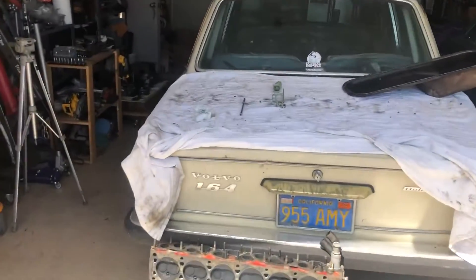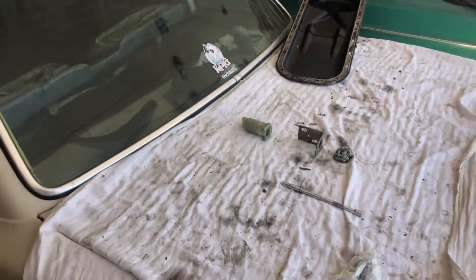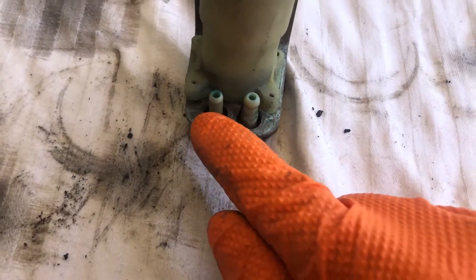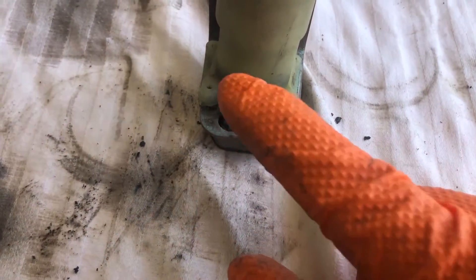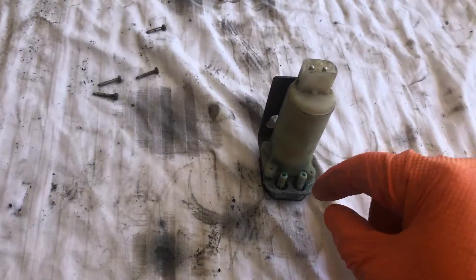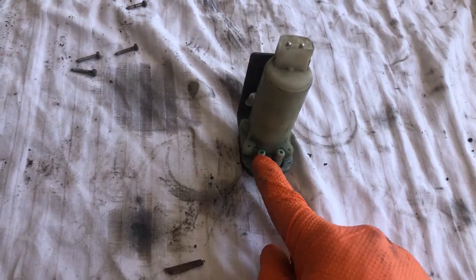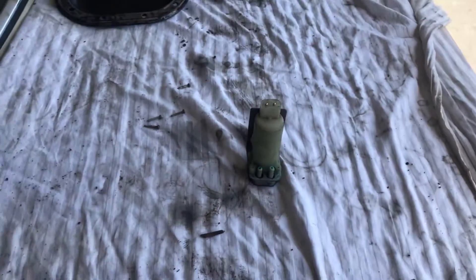My pump was getting power — I could hear it and feel it clicking — but it wasn't actually sending fluid out. The first thing I did was spray a little bit of carb cleaner here and here, because sometimes old fluid that just sits there and evaporates can get gunky. You can see the blue residue — the bottle was pretty dirty inside so I soaped it too. I wasn't actually getting anything on the output side. This is the input, that's the output — it's a slightly different barb.